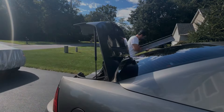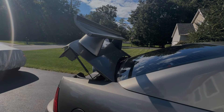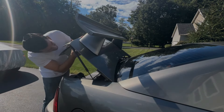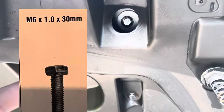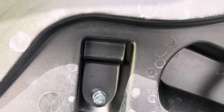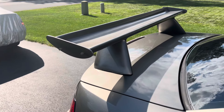Obviously there are some imperfections there. I didn't do any body work on the spoiler — I just primed it, sanded it, and painted it. Outside of those two little blemishes it looks really good, and that's on the front side which most people will see from the back. I felt like I needed more than one can, but honestly it looks pretty good for my skill level — probably better than the paint that's actually on the Mustang now. I'm about 6 to 12 inches away, applying long strokes, and starting to spray a little bit before I reach the surface so it doesn't come out funky when you first pull the trigger — that keeps it from clumping up and running, which worked out perfectly.